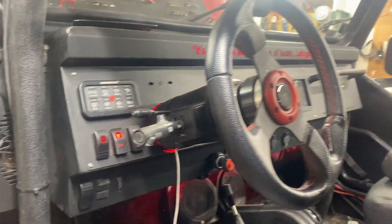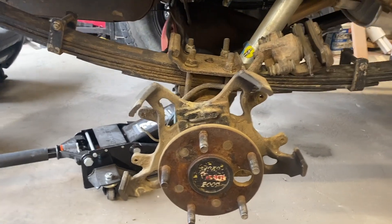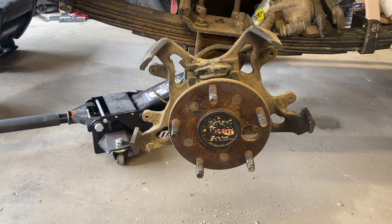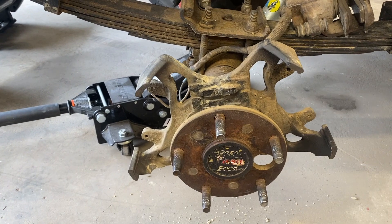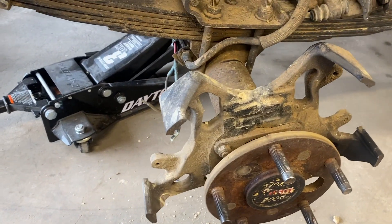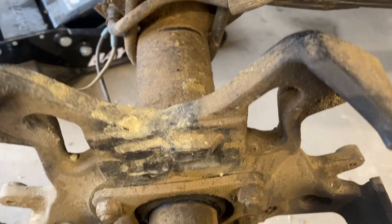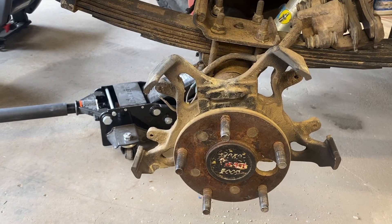I have my circuit breaker right under the dash — keeps it out of the way and leaves me with a clean dash. You will still need to run your brake caliper as well as the electronic parking brake, so you'll need a dual brake caliper bracket. You can buy these online, but all I did was take a Ford Explorer brake caliper bracket, take two of them, cut them both down the middle, and then weld them together. Welding it was easy because after cutting both brackets down the middle, you can mount them both directly to the axle tube and weld straight down the middle — you'll know you're perfectly centered and the brake caliper fits perfectly.